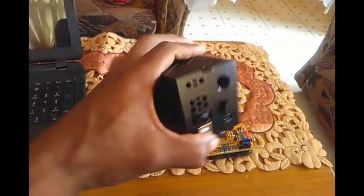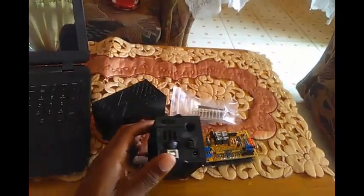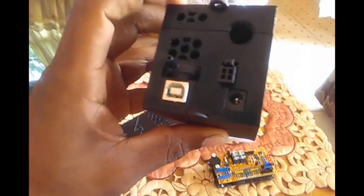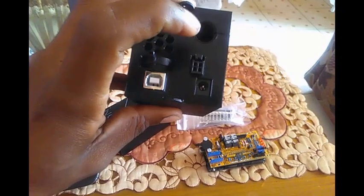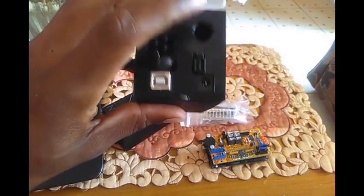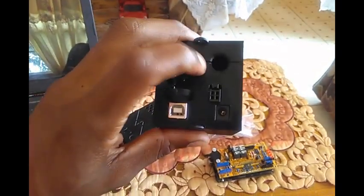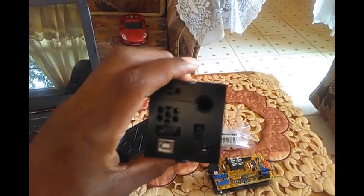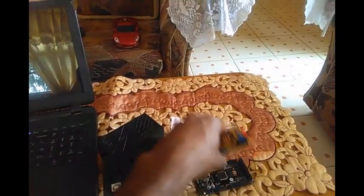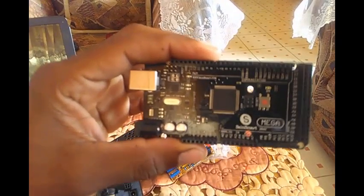You'll have a finished product that works something like this, with your USB port here, the 2.5 bar MAP sensor, stepper idle motor output, and your harness going through here. The front separates into two pieces, so it's fairly easy to get your harness going from there.